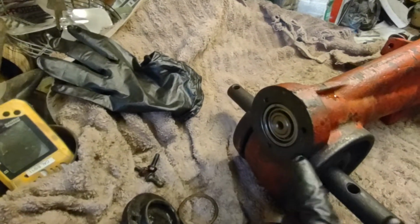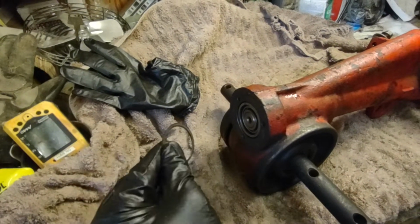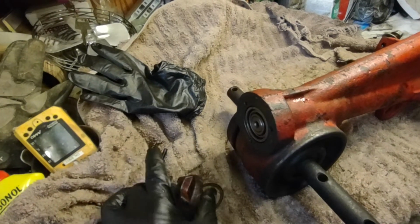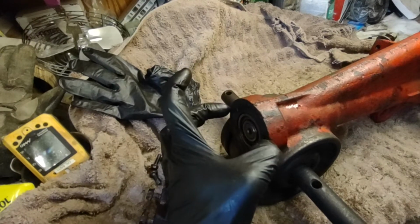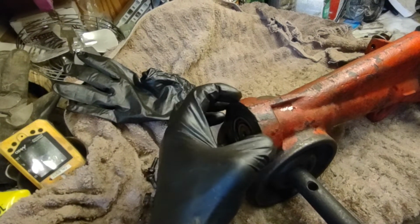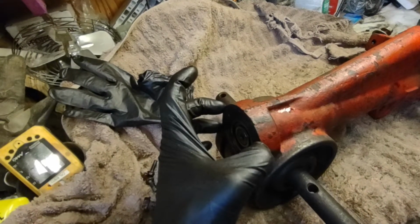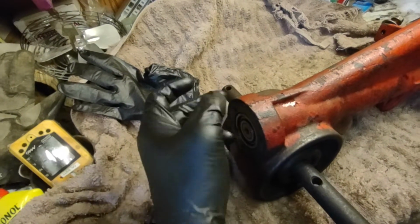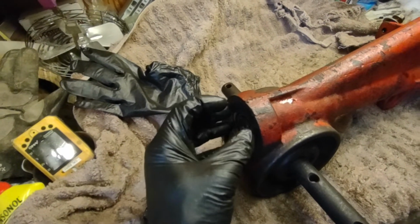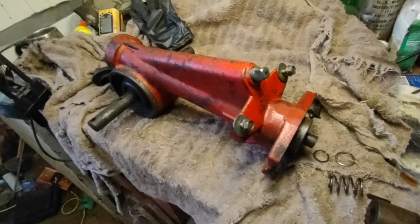So here you've got the 3 bolts for this cap and the shim. Once you pull out these 3 bolts, you can get it started. I've got a leather mallet that I use to kind of pop that loose, get the screwdriver in, and then just work in increments as it comes off. It's a nice tight fit. Now that this comes off, that's assuming this is the easier part, actually.